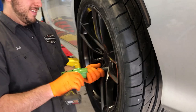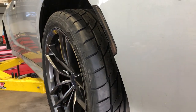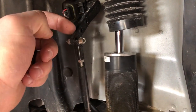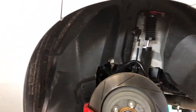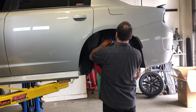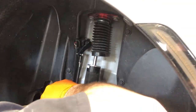As we expected, the arm is actually hitting the rim when we start pushing the tire back up with the bags aired out. We got to about ride height and it was hitting. We're going to have to go into the second hole and then trim the arm. Hopefully that gives us enough. We might have to adjust the rods too, which means I'll probably have to go get the car realigned. During alignment you actually have to have control of the bags because you only get so much adjustment.